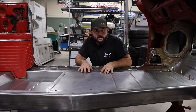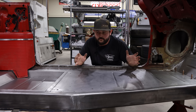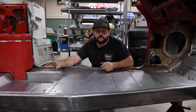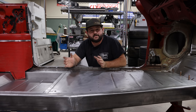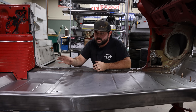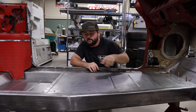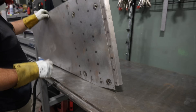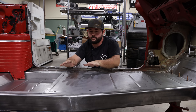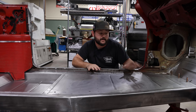To go into a little bit more depth on these floors that were built — they look pretty simple, but they are extremely strong. Basically it's two main sections: we've got a front and a rear. One of the reasons we did that was because we wanted to make sure that we put a rear footwell in here. Because we moved the original seats back just a little bit, it kind of tightened up on that rear legroom area, so we put some footwells in there just to add a little extra space for whoever's sitting in the back seat. And then under these floors there's actually four braces under the front set — pretty simple top hat style braces — and they run from frame rail to frame rail, with one under each of the new seat mounts and two up front kind of where your feet would go.